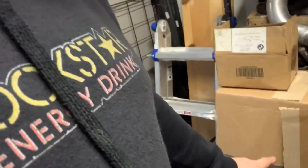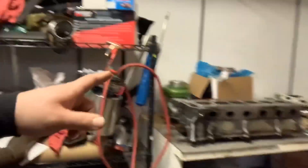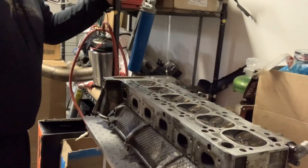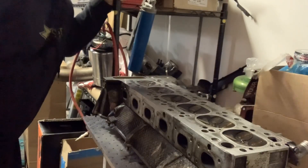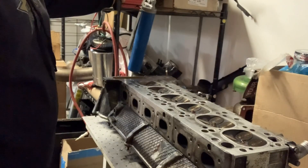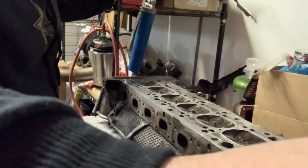This has been some progress. I did get the head gasket finally — it's a cut ring, Pro Seal I think it's called, a copper cut ring gasket. I also have another cylinder head I was contemplating using, but since this one checked out fine, I'm going to use it as is since it's already assembled and everything measures properly. Thanks for watching — if you haven't already, please like and subscribe. There'll be more updates coming as I collect more parts. Enjoy the rest of your day.